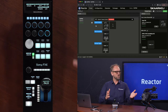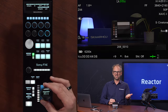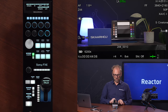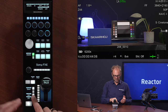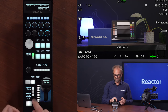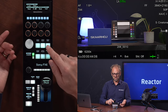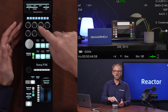With all those basics in place, we can now concentrate on how we can control the camera. You already see that the iris is controllable using the amazing joystick on RCP Pro. We also have the joystick override so we can get the picture on the monitor in front of us. We have standard stuff like shift. We have an engineering menu on the RCP where you can see the IP address of the device and all these things labeled for the display. And then we have the menu, where with these buttons we can navigate the settings, which are adjusted by these encoders.